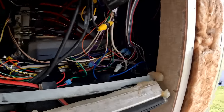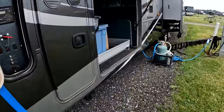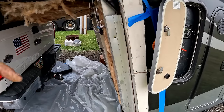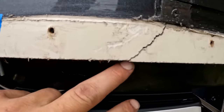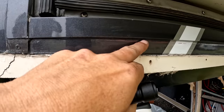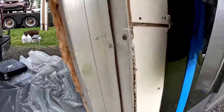Let's get these wires out of here and get a nice good shot. There we go guys — this is pretty bad. This could have ended very badly. Look at some of the signs I was telling you about — I know you can't see this stuff when you're inspecting, but if you start seeing excessive cracks, big gaps, if you see white pop up when you're hitched up, you've got a lot of movement and something's going on. This whole wall here is about to come out.